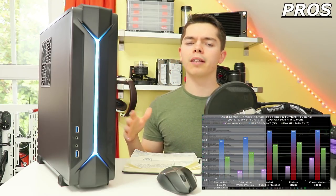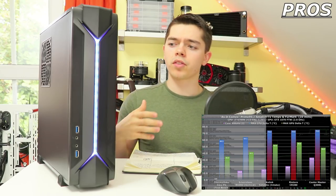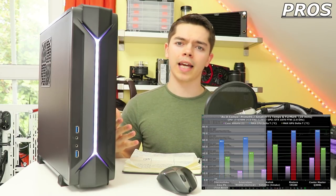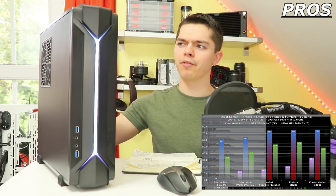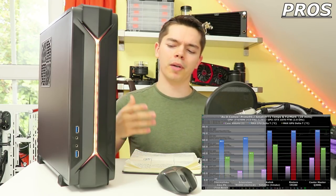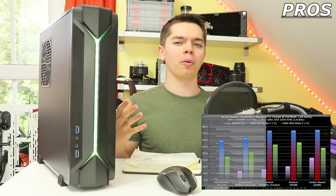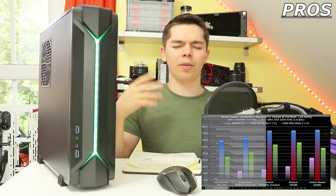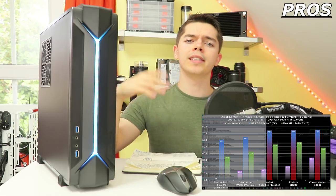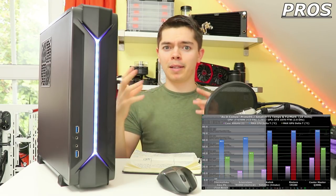And then the stock and max cooling, rounding off the pros, is just unbeatable in my testing so far. So very solid. I don't think you can really push this case to be more impressive in terms of its cooling capability unless you add more fan placements everywhere, but realistically there's just no room for it. You perhaps could upgrade some to 140mm ones, but frankly that would probably detract from the style of the case, because most people are probably going to be using 120s, and a 140mm fan is just going to be a bit too large, I think, in this case. But anyway, if you had 120s on a 140mm cover, you have that band around the edge, which just looks a bit like a missed opportunity.